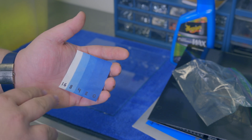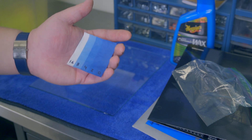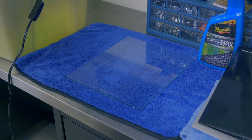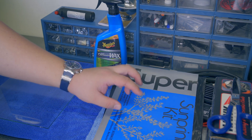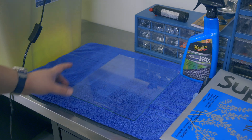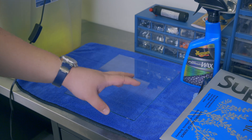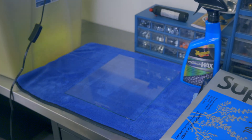I'll use this paper as a comparison strip - so if your sample is darker than a 2 but lighter than a 0 you'd get one point. A regular piece of glass from Lowe's will block all UVB, which is fine since cyanotype reacts to UVA. This piece of glass simulates the clear coat, the paper strip underneath simulates our paint, and the wax product is our protection. We're looking to see that the paper does not expose to UVA as quickly once the protection is applied.